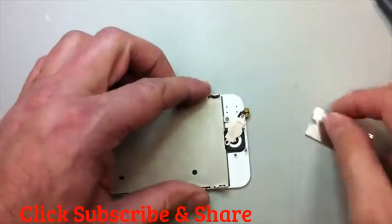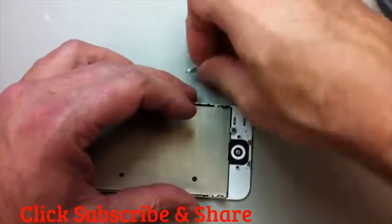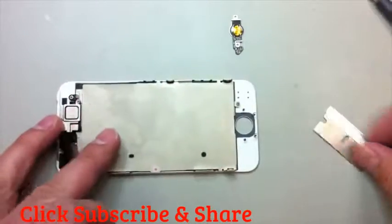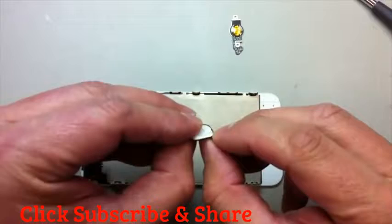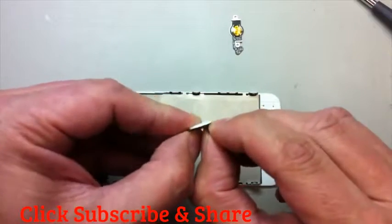You'll see here I'm going underneath just enough to get this disconnected, because there is some adhesive holding that on. And once you remove that, you can set it to the side, and you'll see mine comes right out. You may have to work on that a little bit. Try not to damage that rubber gasket. It is very important. And we are going to continue, actually proceed to remove that from the old home button